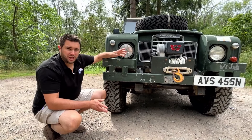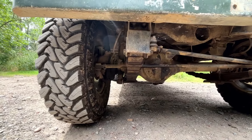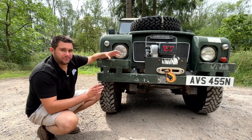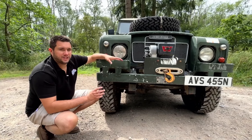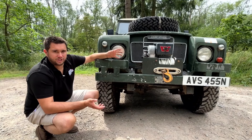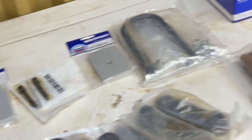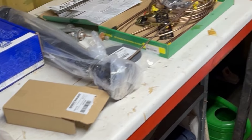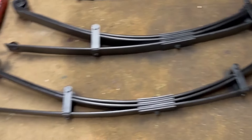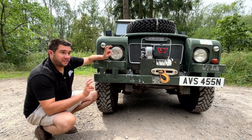One of the changes I want to make while re-chassising is replacing the original leaf springs with parabolics. I like multi-pack leaf springs but on this particular Land Rover the rear - being ex-military - is so stiff that unless you've got tons of weight in the back they just don't do anything. I've taken them apart, cleaned them up, and greased them, but they're rated too highly for what I use it for. So I'll be replacing all four leaf springs with Britpart parabolics and all four dampers with Cellular Dynamics dampers from Britpart, as the original dampers look pretty corroded.